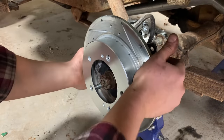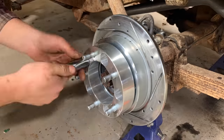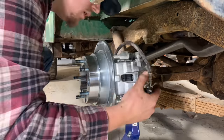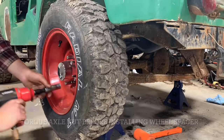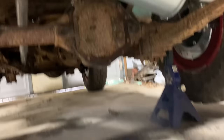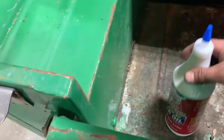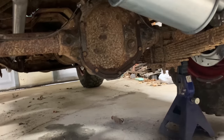Now I can put my rotor back on, my wheel spacer, get all this tightened down, put my caliper back on, and this side will be done. I got both sides buttoned back up now — everything's back together. Once I got done putting them together, I went back and made sure all of them were nice and tight, everything was still good, and put my exhaust back on. Now the last thing to do — and you'd be surprised how many people forget this — you've got to fill that thing back up with oil. I've got this 80W-90 gear oil from Lucas — it's pretty good stuff. I'm just going to fill this thing up until it's running back out of that fill hole right there, and this job will be done.